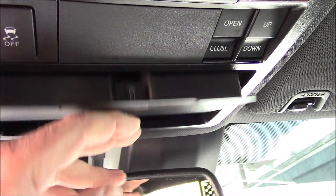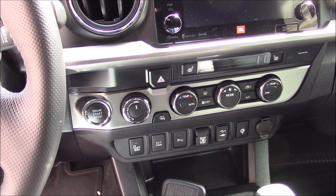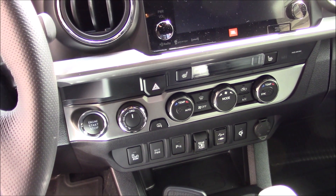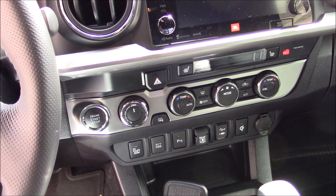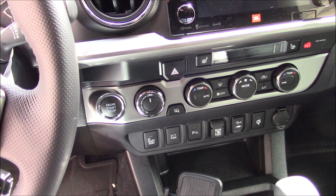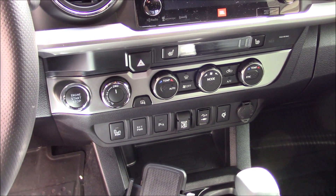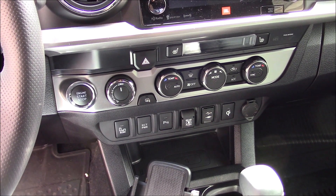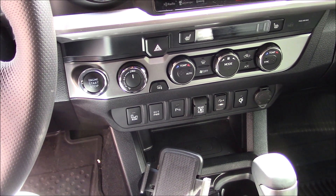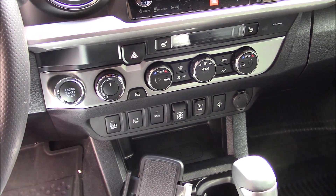All the lights are regular halogens, so I had to put LED lights in my headlights. I got really good ones because I tried to put the cheap Chinese ones in from Amazon — don't do it guys. They don't draw enough electricity, they don't send a strong enough signal to your computer, and they're going to start flickering. You've got to put the money out and get anti-flicker LED lights — they'll be a couple hundred bucks. I tried the cheap ones at like $40 and they lasted maybe five months before my passenger one started flickering and then just stopped working.